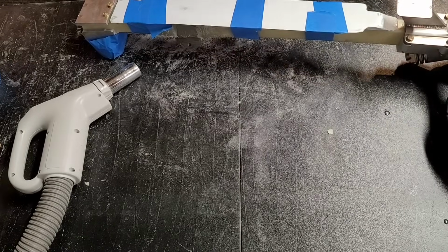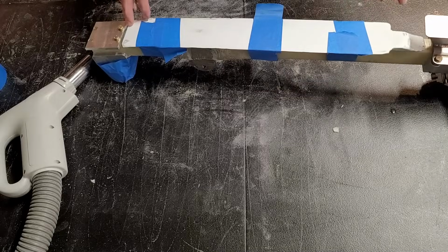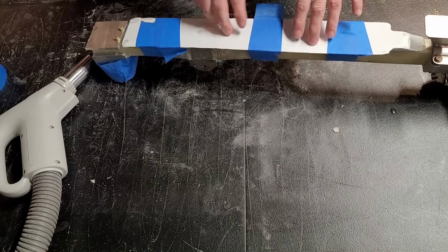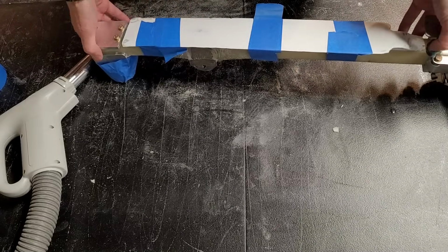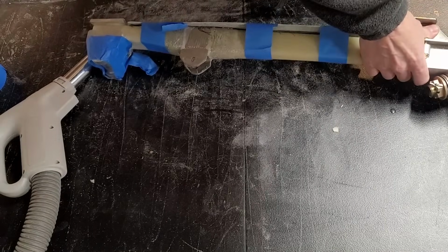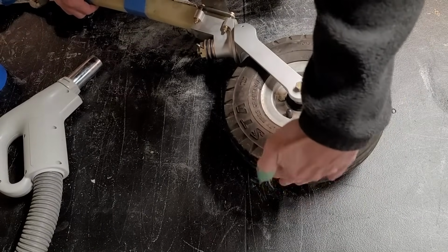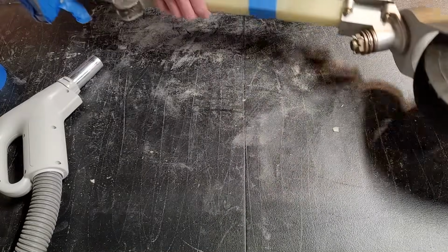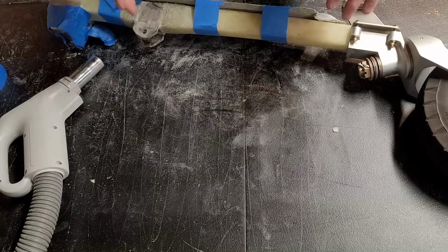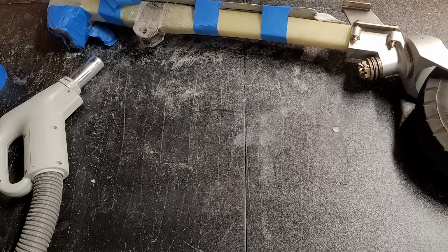So I went out to the airport and set up the strut with the foam that I had glued on there and measured to get the distance that I need from this cover from the strut. And it turned out I didn't need to do any of that, because what I didn't realize was when I took those initial measurements, I did not have the tire on. I just had the strut. Because I had just the strut and it didn't go all the way up, because there's less room than I had realized for the tire to actually fit up there. So when this strut retracts and the tire actually makes contact with the inside of the wheel well, at that point, the cover was actually still pushed outside of the aircraft.